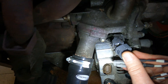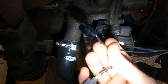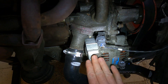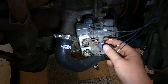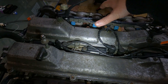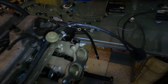Coming down here we're going to go off to our crank sensor over there. Then we've got our MAC boost valve sub harness over there, and then we've got our gauge temp and our ECU temp which will obviously go into the pipe in the front over here. Now on a JZX100 the alternator harness is part of the actual chassis harness, it's not part of the engine harness, so that's why there's no alternator plug over there. I'm just showing you this now with no intake on so you can actually see everything, because it wouldn't be visible once it's all on. We'll go through all the little sub harnesses now.